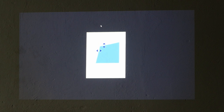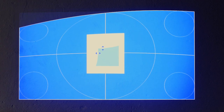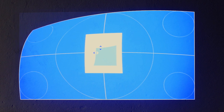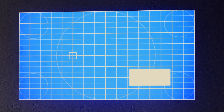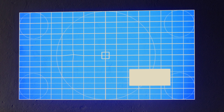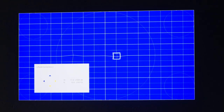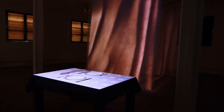There are built-in options to manipulate your image. For instance, there's the easy corner pin, accessible through your remote, so you can set up your projector quickly. There is also something like a Bézier correction — a cushion correction with adjustable control points. And if that's not enough, there's an option to use a grid and correct every single point of the image, which is a powerful tool if you want to correct projection on an uneven wall without relying on your source or a media server.